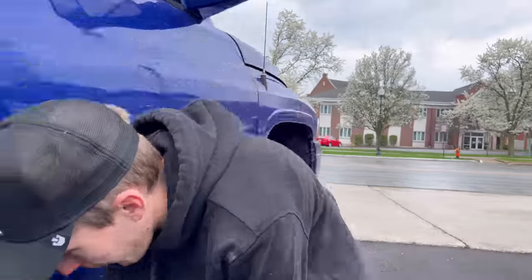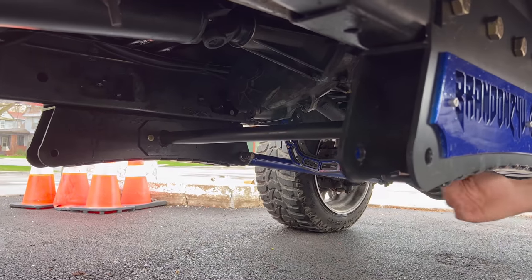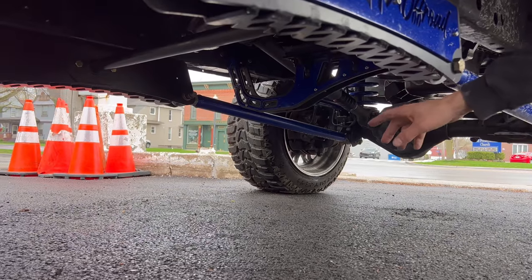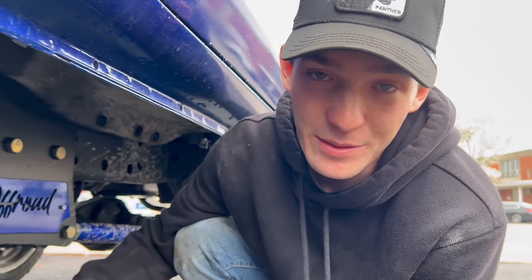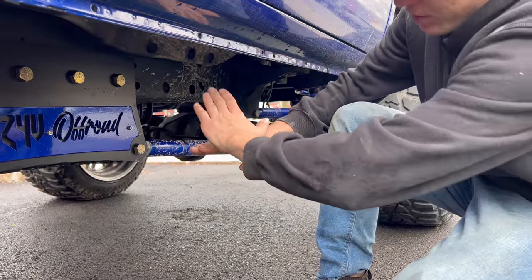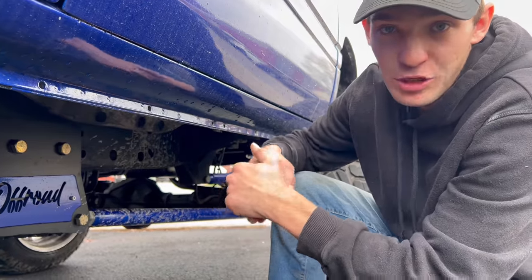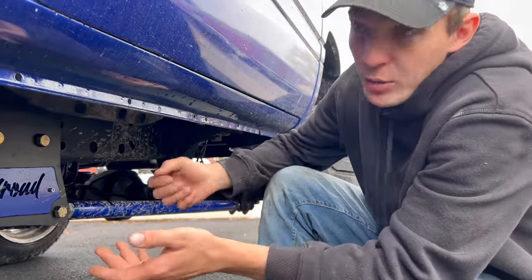Come down here and check it out — there's the cross brace, built out of inch and a half tubing, bolts right in. Trans cross member: the concern is the drive shaft — when the truck is pulled up on the lift or jumps, whatever you might do, the stock cross member causes the drive shaft coming out of the T-case to bind up if you lift it. It'll potentially bend and mess up your transfer case. So that's what we've done to the dually.